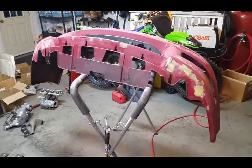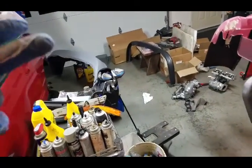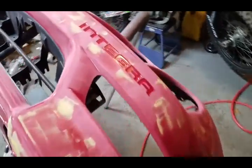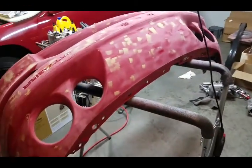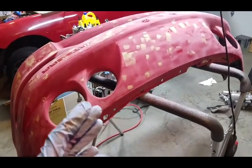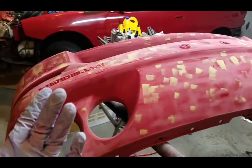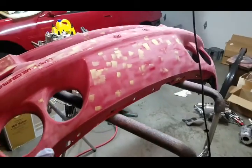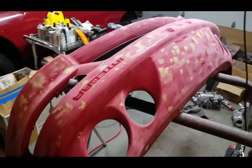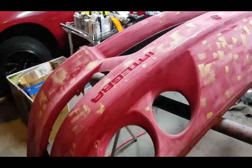Continuing the video — the rear bumper is all primed up, got two coats on it, that's all I'm gonna do. Started on the front bumper and there's a lot of spot putty on it. I didn't really realize how bad my front bumper was. I should probably grab some glaze or icing from work, but I tried to cover up all the rock chips. The primer would do a good job but I just want to be sure.